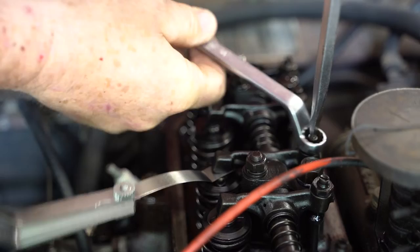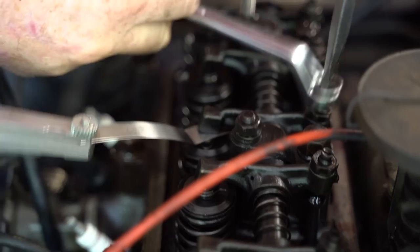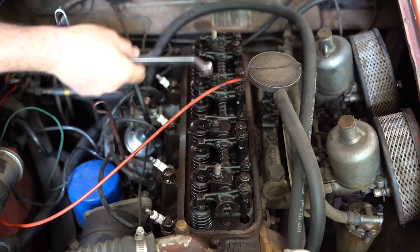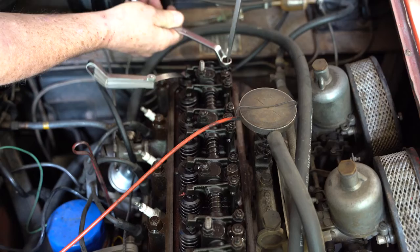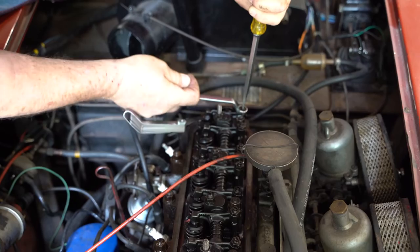Now, some valve manufacturers will give you different valve lashes to maximize what you're buying in their expensive camshaft. So if it says adjust the inlets to 18 and the exhaust to 21, do it. Well, the engine's going to sound a little rattly up there, but you've paid for the cam, so follow their instructions to get the maximum benefit out of this cam that you've purchased. But the original settings are 15 thousandths.